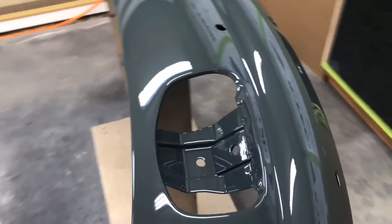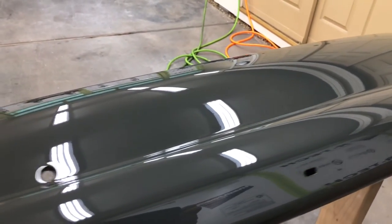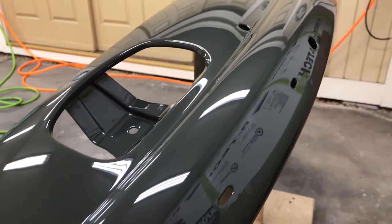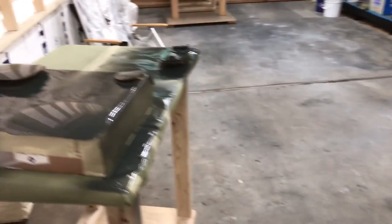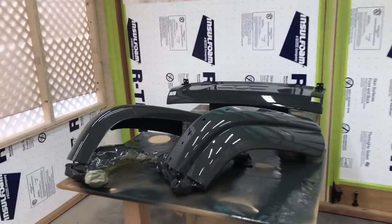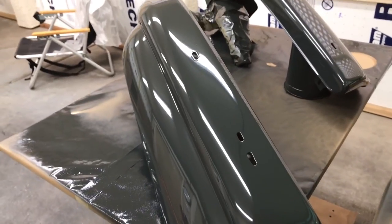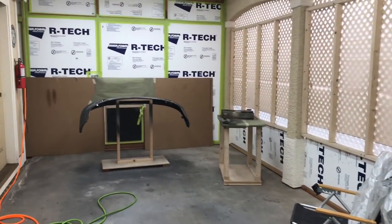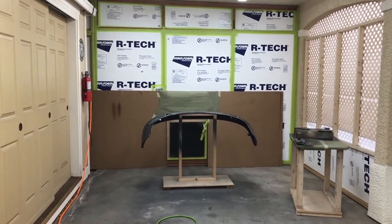Okay guys, that's it for today. Tomorrow I'm going to set up the front fenders and just do those for one shoot, and then the following day we're going to do the shell. This is drying up real nice. Rounded surfaces seem to take the paint a little bit better than the flat surfaces - something about stretching over, it tightens them up real nice. Little pieces turned out real good, nothing to worry about. So let's call that part one of our painting series, and next up will be the shell and the front fenders. Thanks for tuning in and we'll see you on the next video.